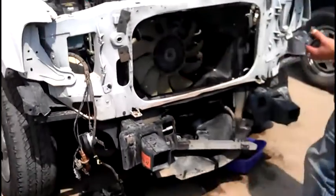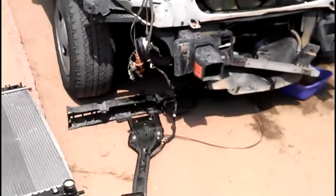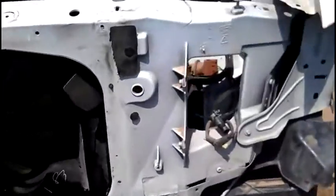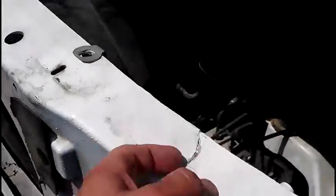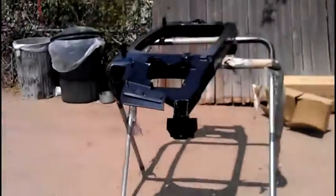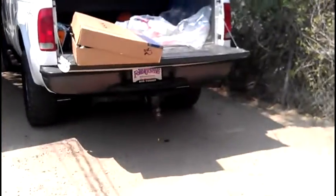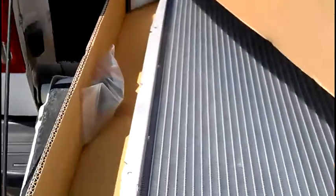Check it out, there's that F-150 — taking it all apart, got the parts for it. I'm going to take the radiator support off, get the parts painted so we can mock it up and slap it together. You can see where it's cracked there, and at the bottom here it has a crack right in the center, so I'm going to replace it. Here's the new one, and here's the bumper — going gray. Got a new radiator, the condenser looks good, and the headlights are there too.